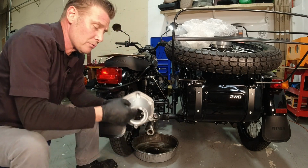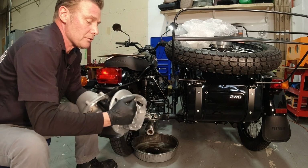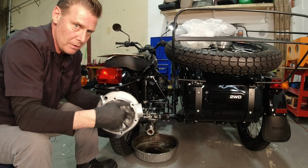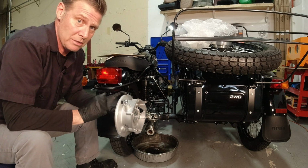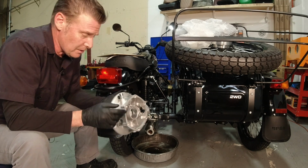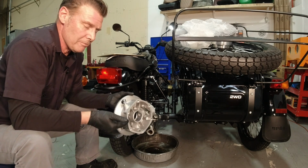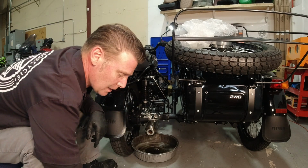The reason for that was primarily due to the breather thing that we talked about a minute ago. When it was back here on the drain plug, in the old days, you would get a little misty ring of oil from heat, pressure, and the ring and pinion gear spinning around, building up. The fluid would evacuate out the breather and leave a misty ring. In hot weather, it might actually cause drips and some gear oil to run down the case, and it looks like a pretty drastic situation, when in reality it was just evacuating what it couldn't hold in the case anymore, doing exactly what the breather was designed to do. Or if it was overfilled, it would correct the level by evacuating out what it couldn't use, what was too much. It would build up and kick it out.